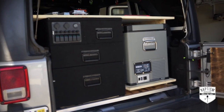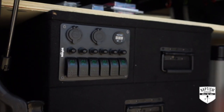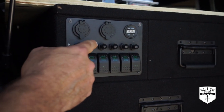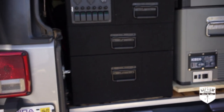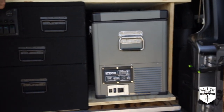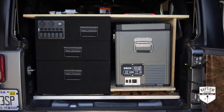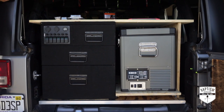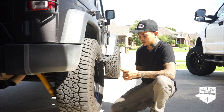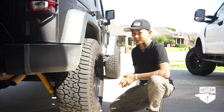We're out here at Chris's house. Got a chance to check out what he just built — it looks really good. He has a whole electrical system set up, with switches, little miniature circuit breakers, three drawers — two big ones and a smaller one at the top for small items. The fridge slides out too. Good job, man. Before we do the lift, let's get some measurements. When we first installed this lift, it was 41 inches. After putting all the weight that we had on it, I am now at 37 and a quarter inches. That's a pretty sizable droop.